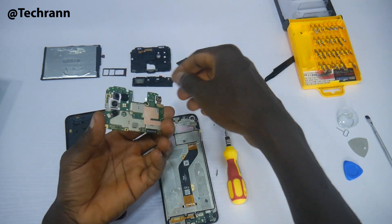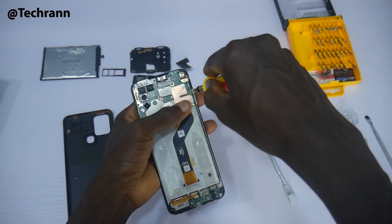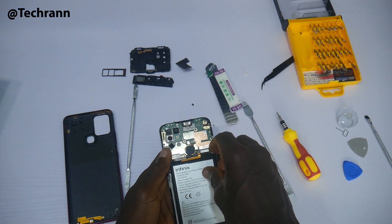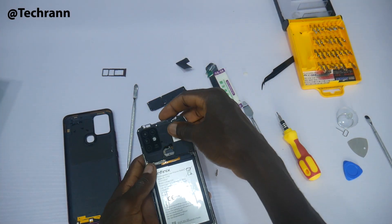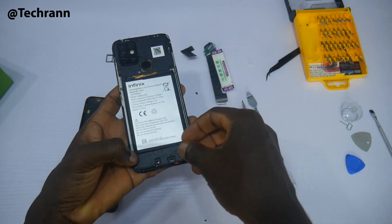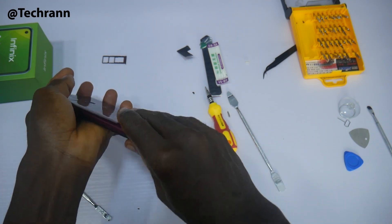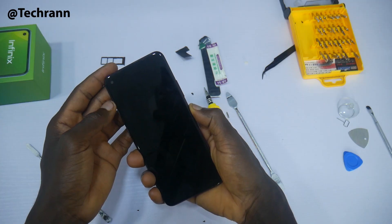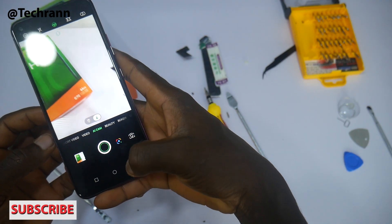Fixing the cameras, replacing the motherboard, connecting the flexible cable, and clipping back the fingerprint scanner. We now turn our attention to inserting the battery, bringing back the plastic back covers, and replacing the screws. It's time to bring back the main cover and cover the back of the phone — and then we turn it on. And yes, it came on just fine. Everything works fine.